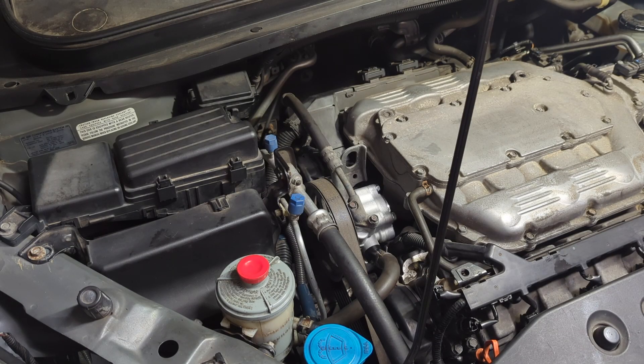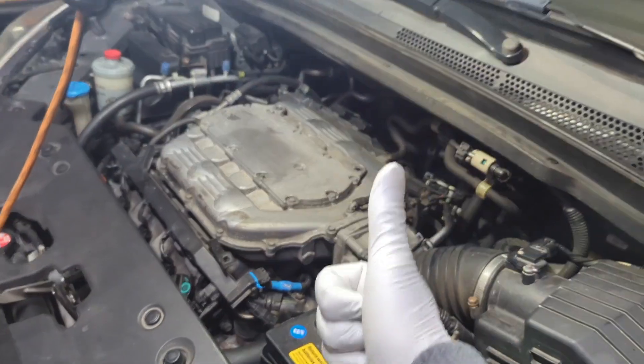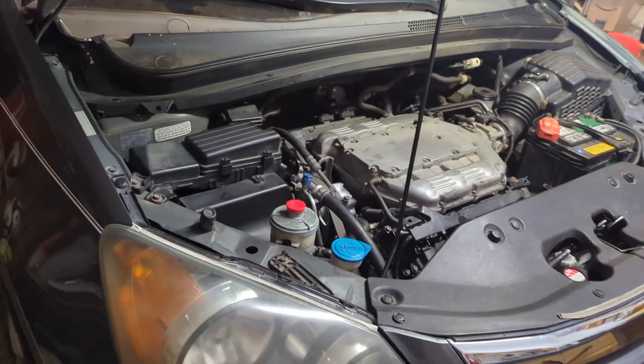The factory power steering pump lasted 120,000 miles; it was replaced with a remanufactured unit from BBB Industries which has already lasted 45,000 miles. This replacement is an experiment using a non-brand aftermarket part to evaluate reliability. As a precaution I'll keep the BBB pump, some fluid, and necessary tools in the trunk for emergencies. My final recommendation is to always use OE parts if within budget — five years ago the OE part from Honda was too expensive so I found the BBB Industries unit and was really happy with it. That's it for today — if you found this helpful, give us a thumbs up and subscribe to Professor's Garage. Until next time, may the Lord bless you and give you peace.